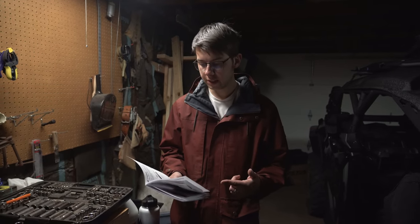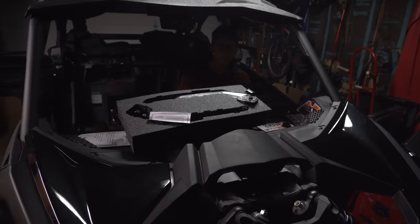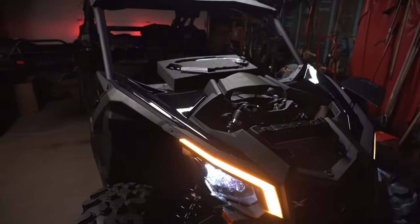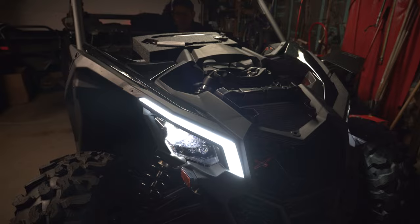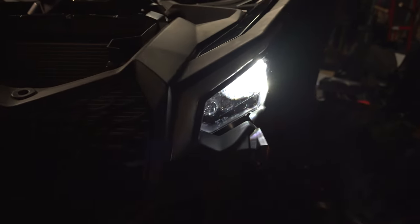At this point we're going to be putting the original fuses back in — it's a 10 amp fuse for the turn signals and a 15 amp fuse for the horn. After that we're going to reconnect the battery, re-hook up the lights to the front end, and test everything out before zip-tying everything down. We got the battery reconnected, we're going to start the side-by-side up and run through it to make sure everything works. Ready for a horn? Let's go. Quick right turn. Left turn.